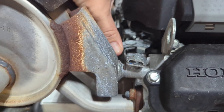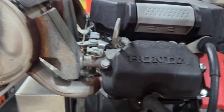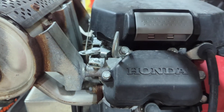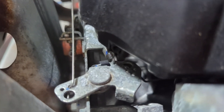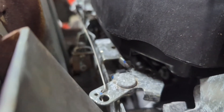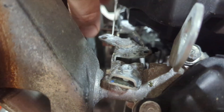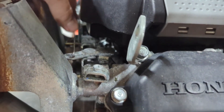Versus this one which is smooth. So I'm going to put some WD-40 on it. We've got a big job today — granted, you don't put your hand next to the muffler — but if all it takes is this to get the job done today, let's do it. I'm going to spray some WD-40 and get that cleaned up. You can see it's got a little bit of oxidation, a little bit of corrosion on it. The spring itself looks okay, but we can rule that out. It really does seem like this wire has gotten bent a little bit, so I'm going to try and bend that down as well.